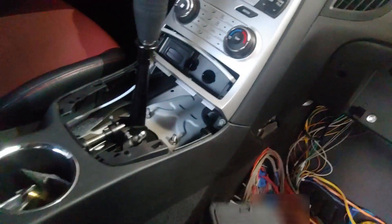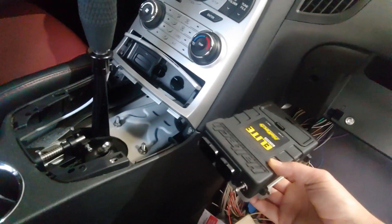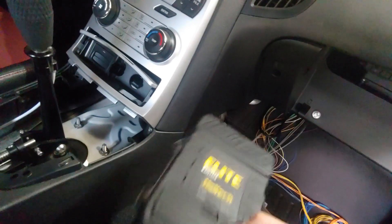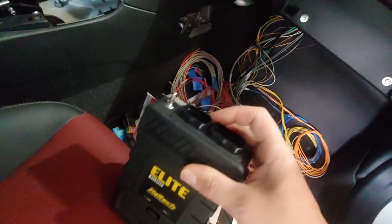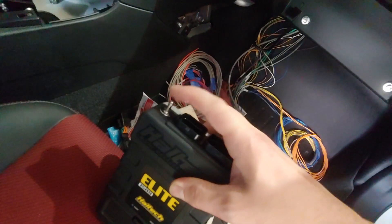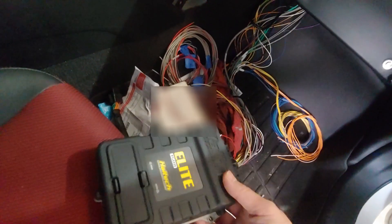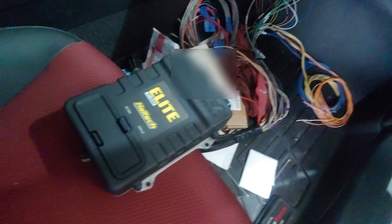What I did was route those wires — there's a little plastic cover I took off and I just slit that grommet open a little bit and routed the wires through there. Long term I'll try to slide it in under the center console. The connections I need I can just run up through here. It actually has a port on there with wires you can run to your own solenoid, so you can run a boost reference and now you don't need a separate boost controller. This will be your boost controller — you won't need something in the car to adjust boost pressure separately from your maps.